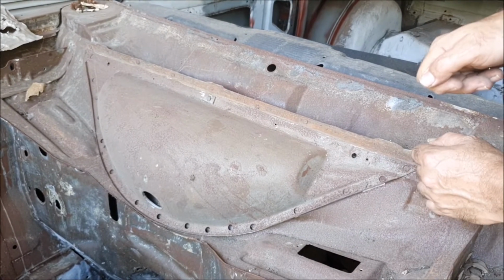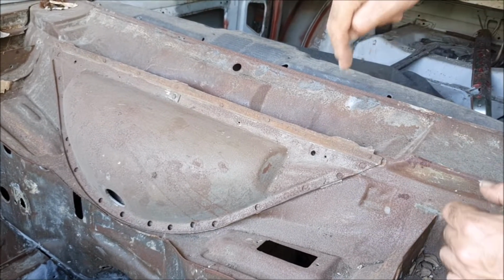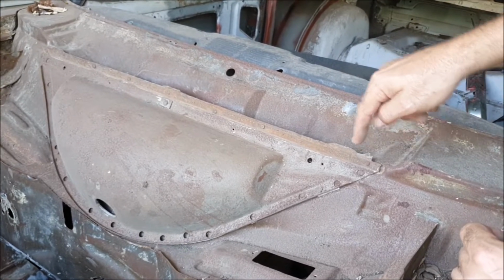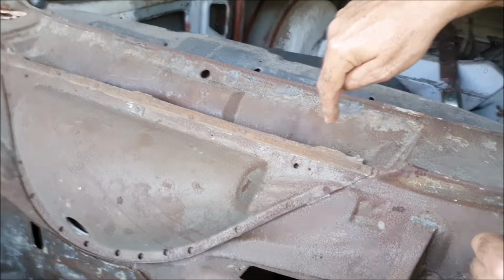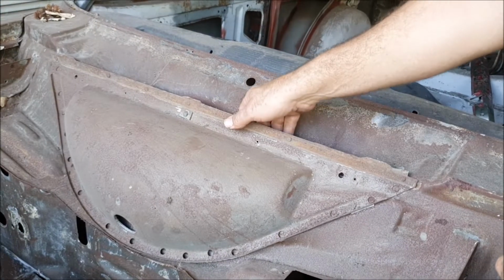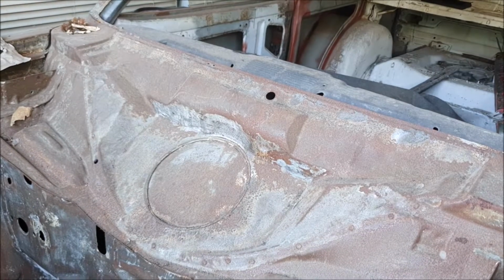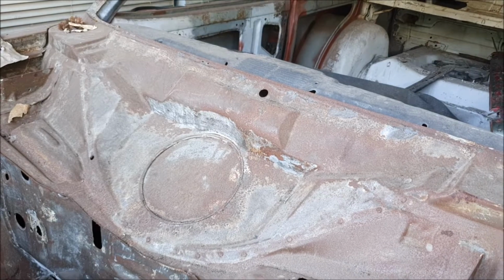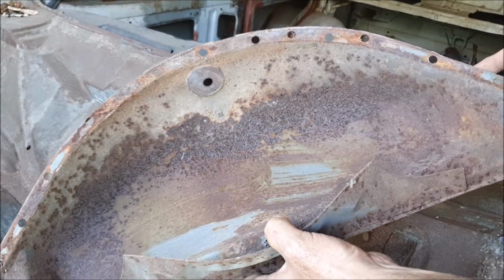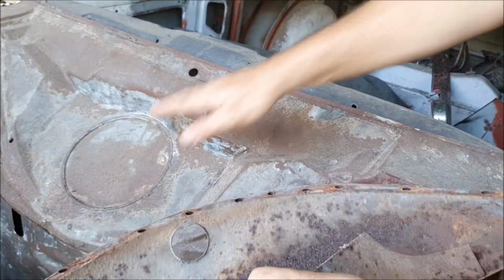So yeah, it's easier to put a center pop in the middle of the weld than a pilot drill, which I find is good to do these days. Maybe if you can avoid going straight through the metal, it's saving a job to weld up later. But yeah, basically just spot weld all that out, and that will then pop off to reveal the underneath. So you can see they do tend to suffer. There will never have been any paint under there, either on that or on that.